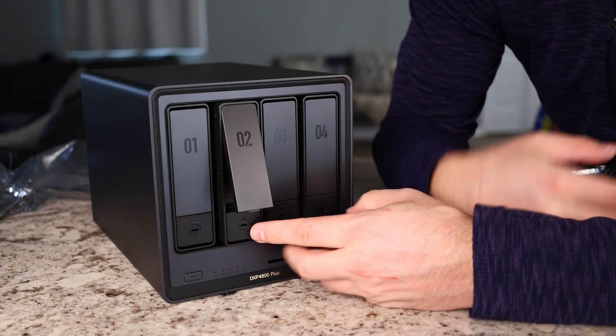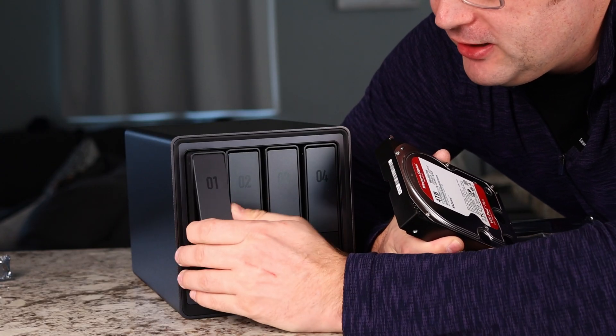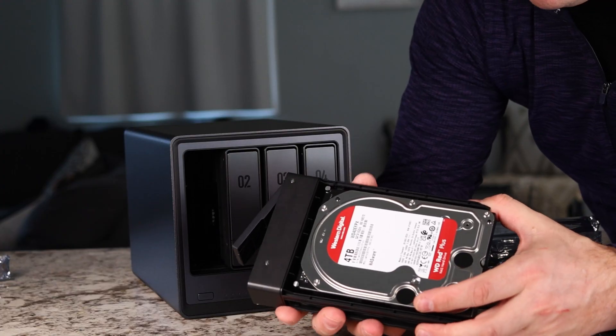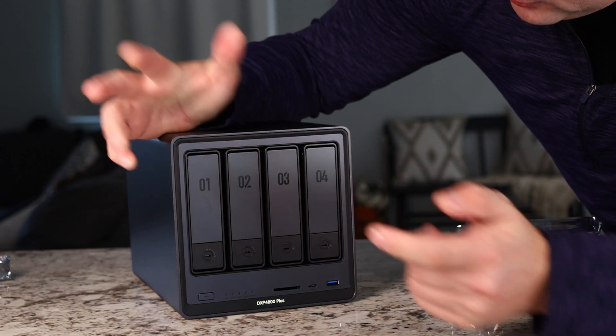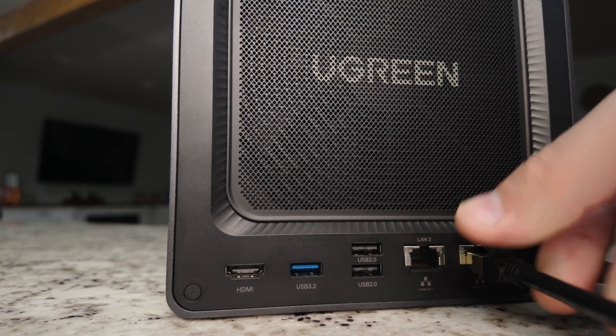You'll want to install at least two hard drives to begin with. Installing them is easy — you just push the button, the hard drive holder pops out, expand it using the tab, line up the hard drive, slide it back together, and slide it into the Ugreen. The hard drive is installed. You'll want at least two drives due to data redundancy — if one hard drive fails, you can replace it without worrying about losing any data. The NAS will walk you through that. Once your hard drives are installed, plug a network cable to your router. It does need to be hardwired, as this is how you access your data anywhere in the world.